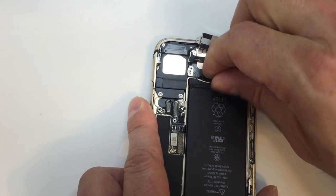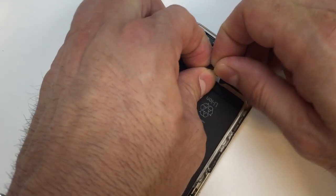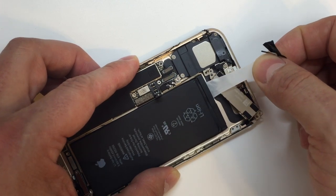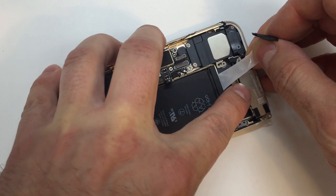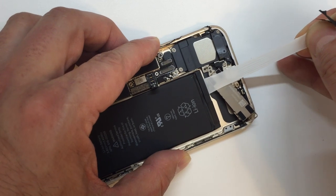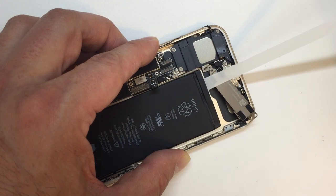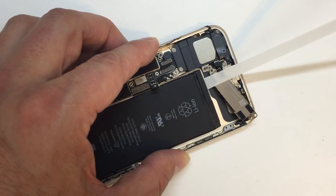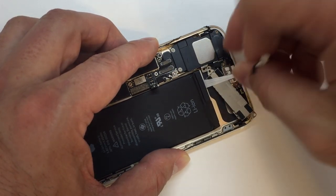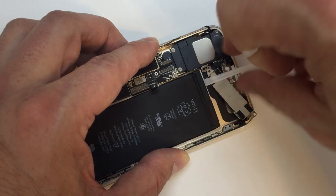Fortunately, if it gets really bad and you tear it off right in the middle, so you only get part of it, you can usually reach inside, again very carefully with some precision tweezers, and grab a small amount of this white stuff and pull it straight, almost at a 45 degree angle. So I'm not going straight down, I'm not going straight up towards the ceiling, I'm just coming out at an angle here. One steady, smooth motion usually works the best. If you get lucky, you might get the entire strip. It's actually still pulling out at this point. These things end up being quite long when they're stretched out, and you see, I kind of lost my grip on it, but I can go back in there and grab hold of it again and keep pulling slowly and steadily if possible.